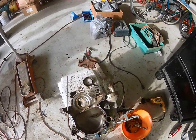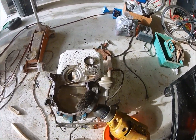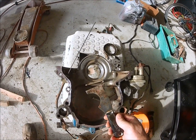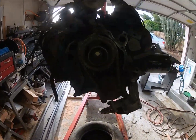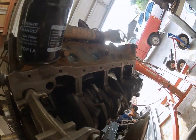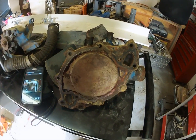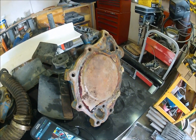This is all cleaned up. Use your scraper and wire brush to go ahead and clean that up so it's nice and smooth and perfect. Scrape it out nice and easy — try not to gouge it. We're going to put on a new oil pan gasket as well. Get the surface all cleaned up and brushed off, including the back of the water pump.